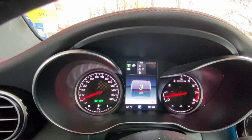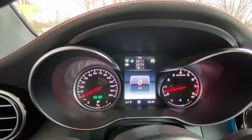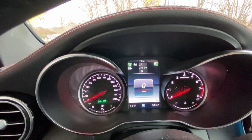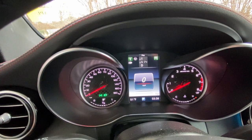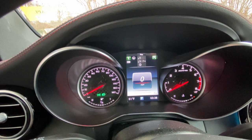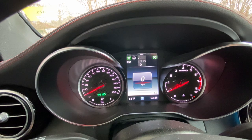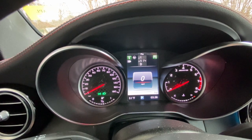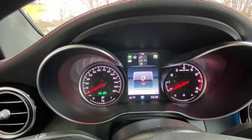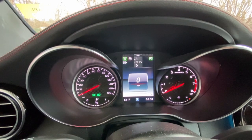We're about to come to a stop — let's see if the engine turns off. And it did. So it was a weak battery. The battery was four years old; otherwise the car was functioning properly and would always start right up. But I guess it was a little on the weak side — the car detected it, so it wouldn't auto shut off at a red light and restart when you lift your foot off the brake. Problem solved. Hope this helps somebody. Thanks for watching.